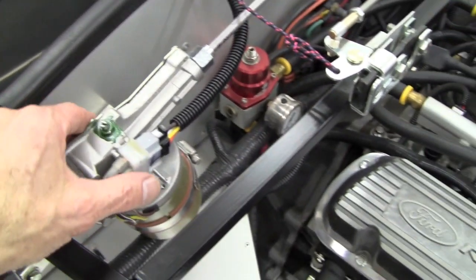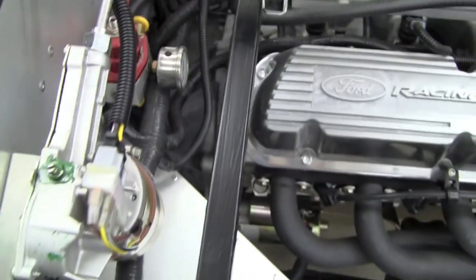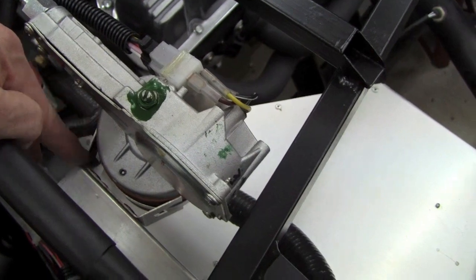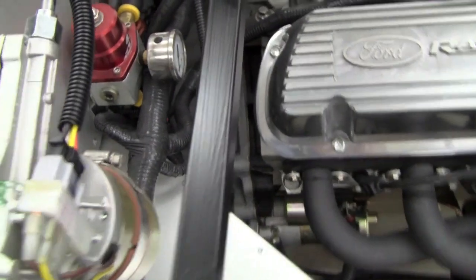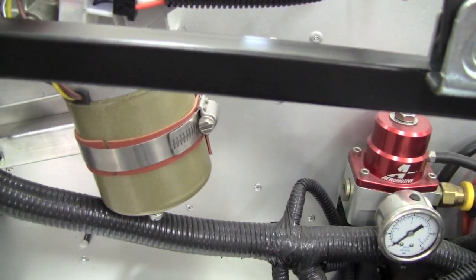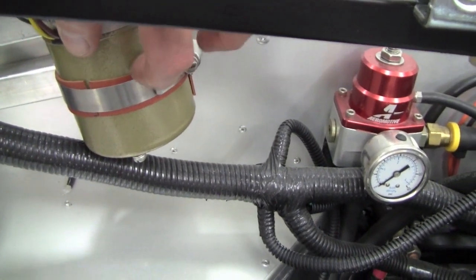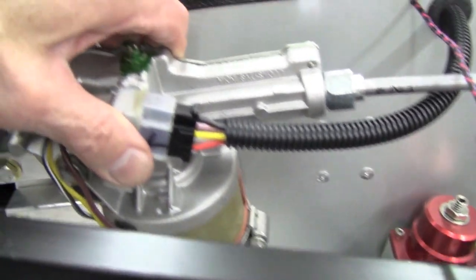Here is your wiper motor here. What we've done is used our Breeze EFI fuel filter bracket to give us a solid mounting arrangement, a solid mounting pad. And that clamps onto the wiper motor with a nice Breeze Industrial Products hose clamp. We cut a piece of gasket rubber to wrap around the motor and give that clamp a real good grip on it.